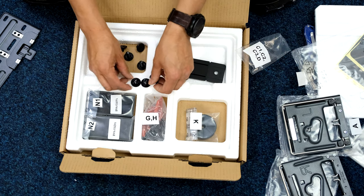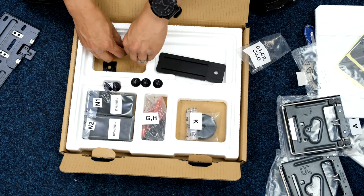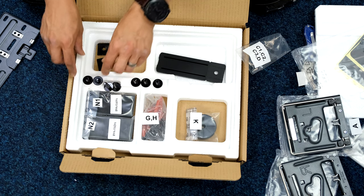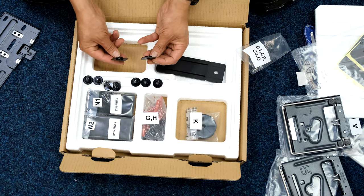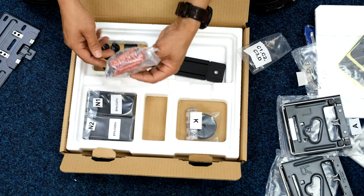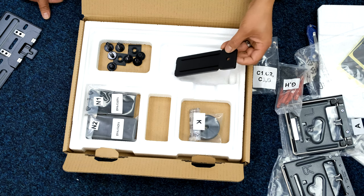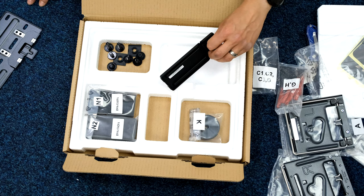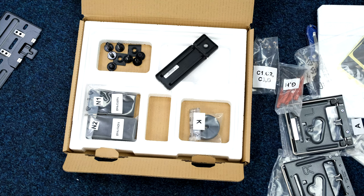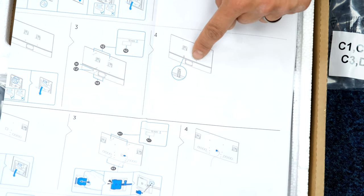There are three 20mm bolts, two 25mm M8 bolts, and two 12mm M8s — the instructions tell us which TV they refer to. There are also two plastic spacers, wall fixings with rawl plugs and screws for brick or concrete walls. This part here — depending on the model — is for models that have horizontal channels at the lower part of the TV, like the AU8000 or AU9000, where wires can be gripped in.